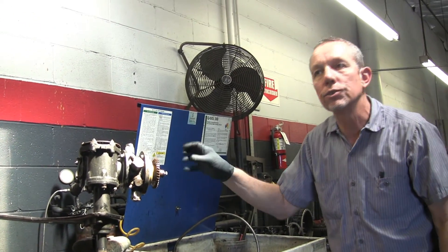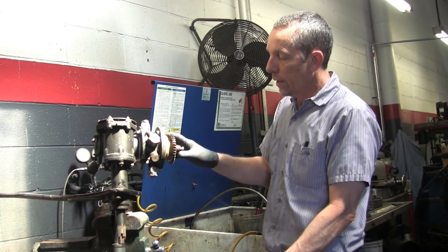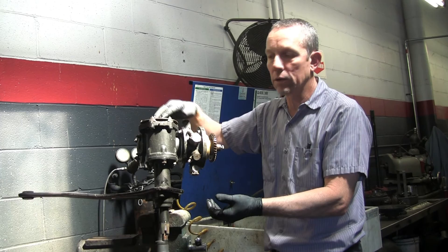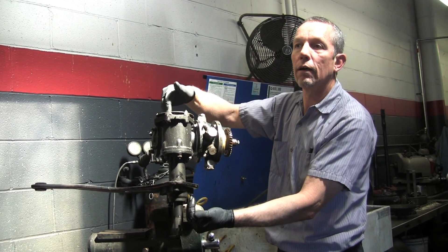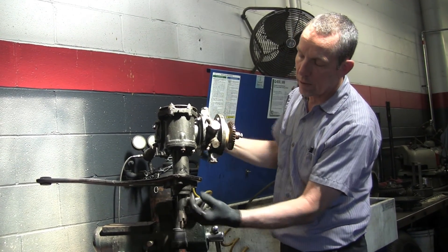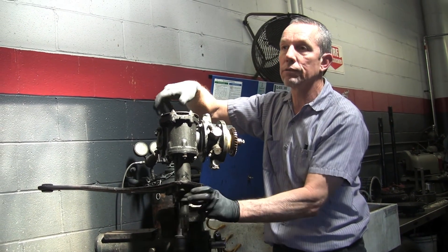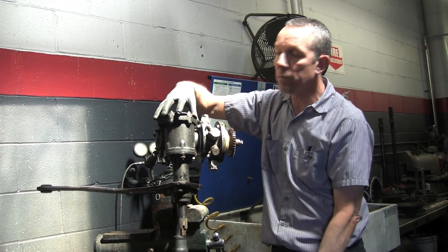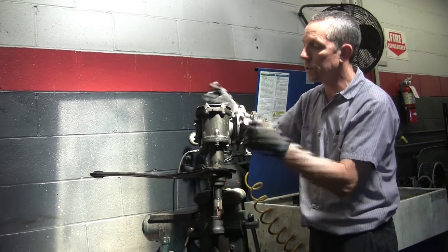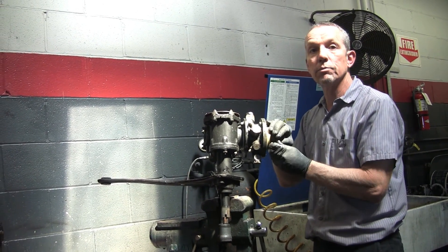It should just be maximum a couple of inch pounds — it's a feel that you get. This one is really too tight. The way this is adjusted — the mesh — is you move this shaft in and out. This shaft has tapered bearings on the bottom and on the top, and these plates are offset, so you can adjust the mesh by turning the upper plate or the bottom plate. Somebody has adjusted this incorrectly — they tried tightening up too much play in the steering and got it so tight it's reacting wrong.